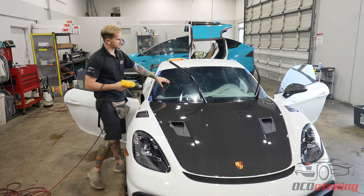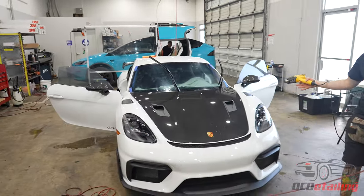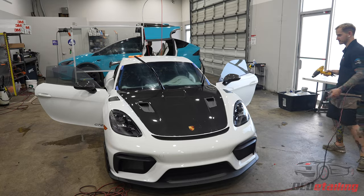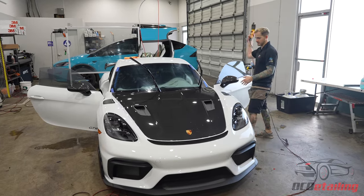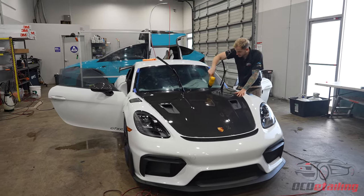We're doing the 70% on this windshield. The 70% is almost completely clear — it's actually the same darkness as clear glass. So it'd be like just layering another layer of glass on there. It gives you 100% visibility still, but it gives you amazing heat rejection properties.